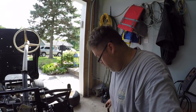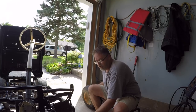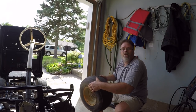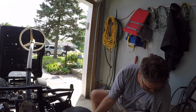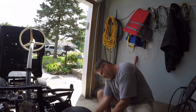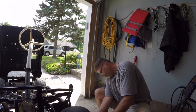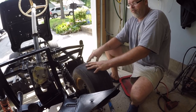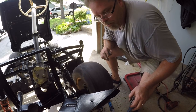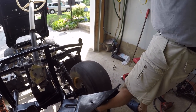So we'll slap the old tire back on and give her a wiggle to see. Should put some grease in there too but that one feels good. The other side is wore out - need some bearings on the other side. Next I've got to check the back brakes because they're a little stiff. When I put my 1000R1 in here I want to make sure she's going to stop. Look at that - 100% better. She had one hell of a wobble before. Let's drop her and see if she hasn't got more stability.